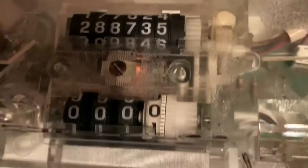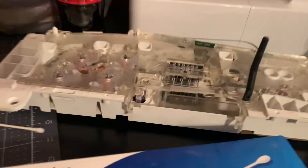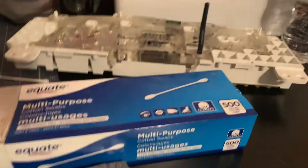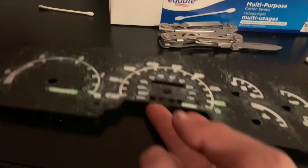I've already exchanged my LEDs in here. You can see there's one right above the odometer in the back, and then there's one sitting back there. What I noticed is I put it all in and they didn't light up, because the green tint was too dark. Being blue, it just didn't want to be a nice crisp blue — the green tinted to the other side. I've gone ahead and scraped it away and made it all nice and white.